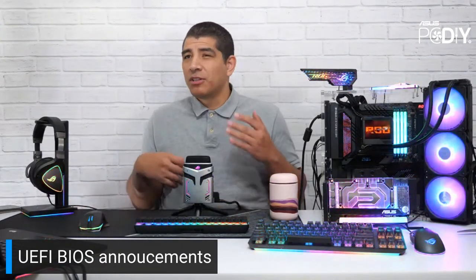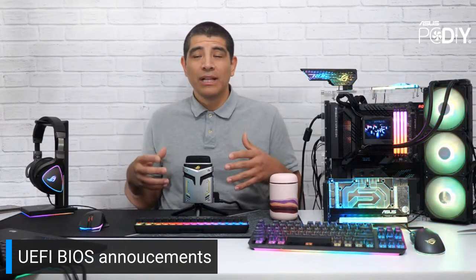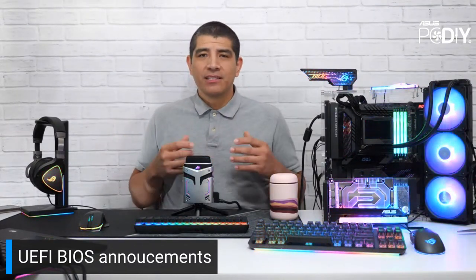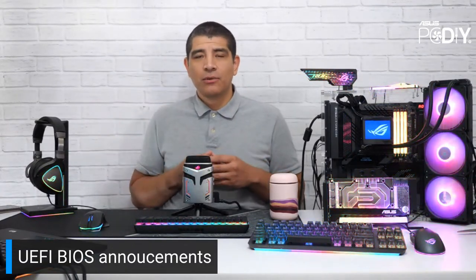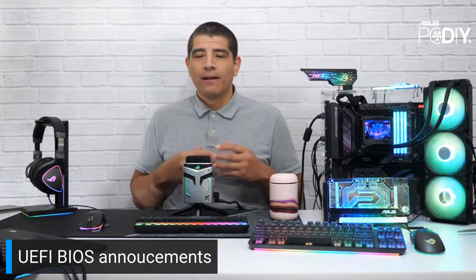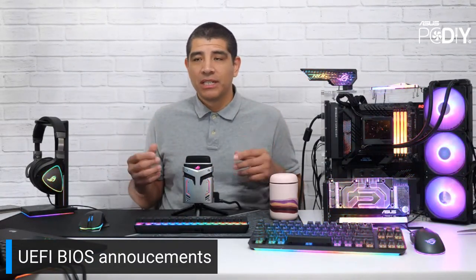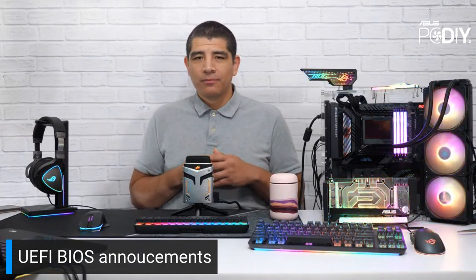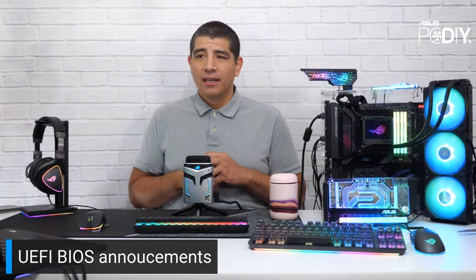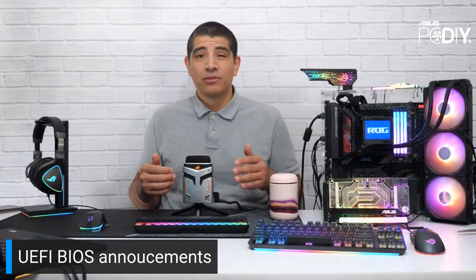But for some of you that might be running the AM4 based platforms, we have been working on continuing to finalize the rollout of our AMD AGESA 1.2.0.7 release. That is the latest formal release from AMD, which helps to add in things like resolution to fTPM stutter, also helps to maximize latest generation support for the newest CPUs, things like the 5800X3D, as well as formalized Windows 11 support if you haven't made that transition over yet. And there's also a couple of other things in there like USB interoperability, compatibility and enhancement for some users that were experiencing that.